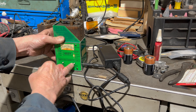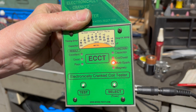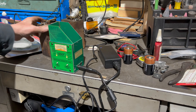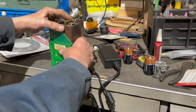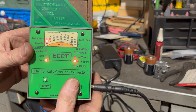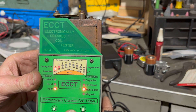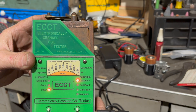The dwell is bad. You can hear it sparking. It's poor too. And this causes a problem — you don't have a lot of horsepower to start with on a Model T, only about 20. And if your coils are bad and not performing like they should, you have a huge power loss. We're on multi-spark again.